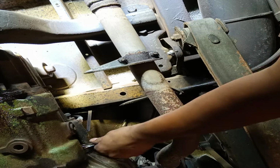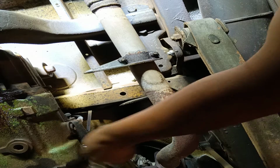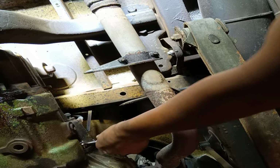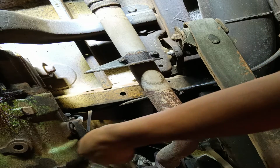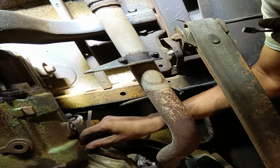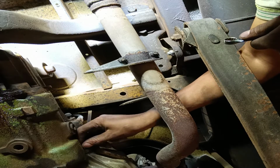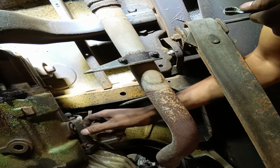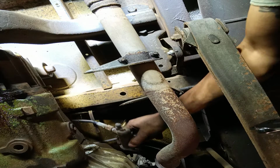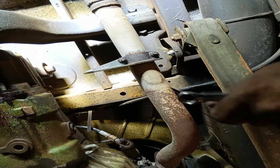With this being a full size camper, obviously the clutch is probably one of the most strained components. So the engines on these are typically derated to the amount of power they can actually take, and these gearboxes are bomb proof. They also put them in the G-Wagon. It's a full cast iron design except for the bell housing. The whole box is cast iron, so very strong boxes, could handle a hell of a lot more power if we really wanted to, but we wanted them to last a long time, so they over-engineered everything. Oops, do not want to lose that. That was another nut.